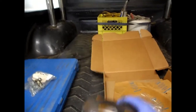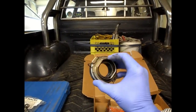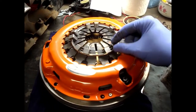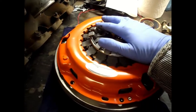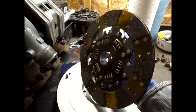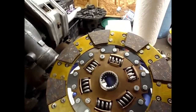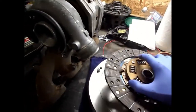I'm also putting in the Centerforce DF501110 clutch, and the throwout bearing is B590. Here's the Centerforce clutch — it's got these weights on the big ring. The idea is when you rev it up and the clutch is engaged, these weights fly out and put more spring pressure on the disc. The disc is a special disc — it has half the number of pads on this side, but each pad at half the surface area equals double the force on the remaining surfaces.